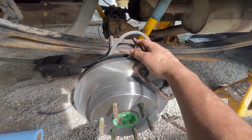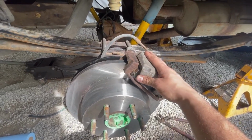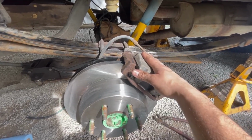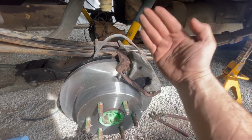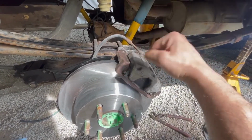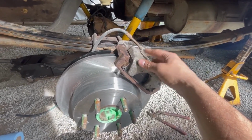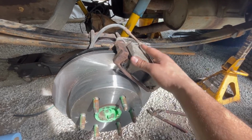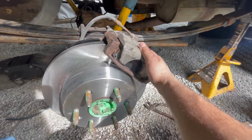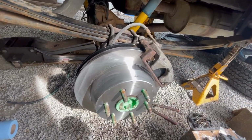And if bleeding would become a problem, it's very much like some of the slave cylinders you might have to bleed on a truck, especially the square body I had. It's actually standard procedure in the manual that you unbolt the slave cylinder, clock it at a 45-degree angle so you can get that bleeder screw pointing up, and then you actuate the clutch and bleed it that way. You can do the same thing here if we absolutely had to, but I don't see why we would. But if we do, we can do that. I'd rather do that than leave it down here, susceptible to road crud, farm crud, you name it. So I go with this. I think that's the best option.